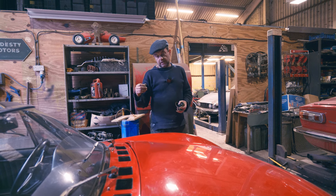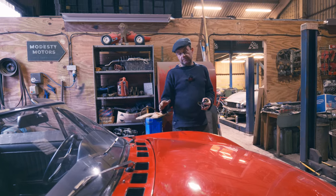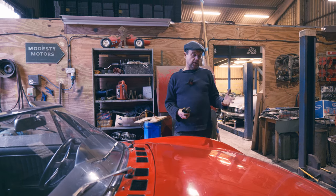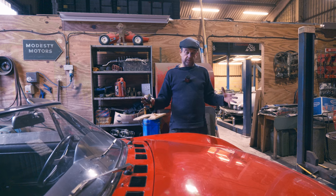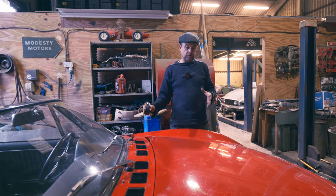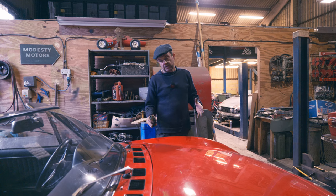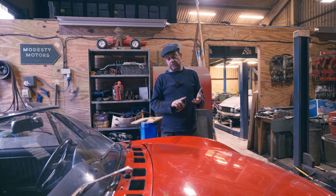And simultaneously, I think they changed that plate with the holes in it. And that's a Series 1 to Series 2 thing. And they changed the pedal box on the coupe as well. Now, the way these cars were constructed is that there was a platform made, and Fiat were making that platform themselves, and then they supplied it to the coach builders. Now, the coupe is slightly longer, so it has a slightly different platform, effectively. But that bulkhead area is the same on both of them. So that would be consistent between Series 1 and Series 2, that changeover.